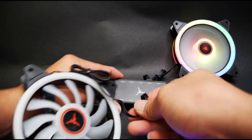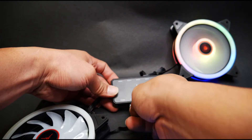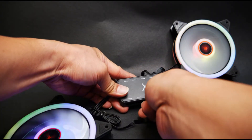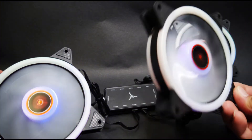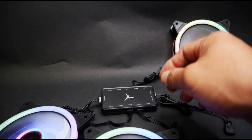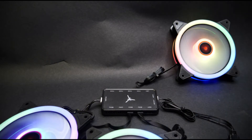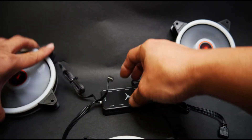To demonstrate: if I plug a fan on connector number 7 — no lights. But if I plug it in on fan 6, there we go — fan 5 and fan 6 both light up. So always keep it in sequence. That's pretty much all you need to do to troubleshoot it. If there are no lights at all, that's another issue we're going to tackle right now.